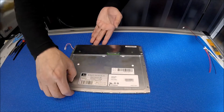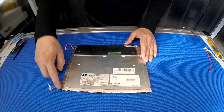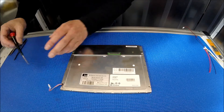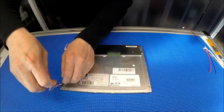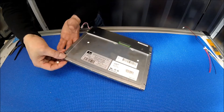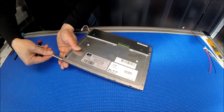In order to upgrade from CFL to LED, it's pretty easy for this particular screen. There's a screw holding the reflectors on each side. So let me show you on this side first. Just grab the wire and slide it out.